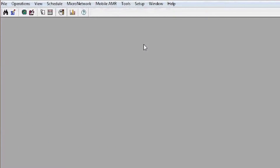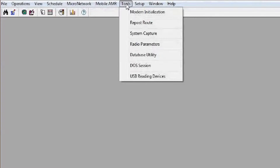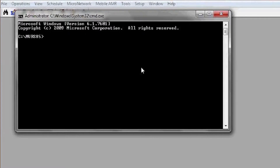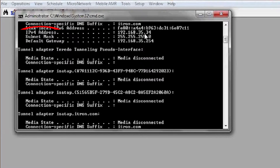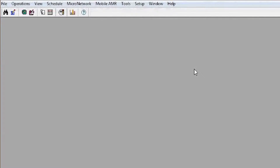The first thing you need to know is the IP address of your PC. The easy way to do that is when you're inside of MBRS, go along the top to where it says Tools, click on Tools, then go down to DOS session. Inside that black window that pops up, type in IPCONFIG, hit enter, and you will see a bunch of entries. The one you're interested in is the one that says IPv4 — in this case it's 192.168.35.34. Make a note of that and close that screen.